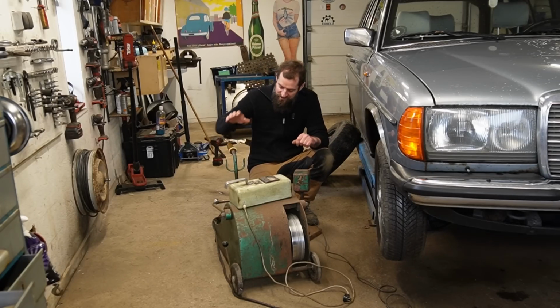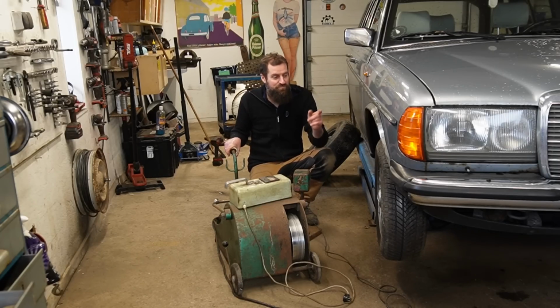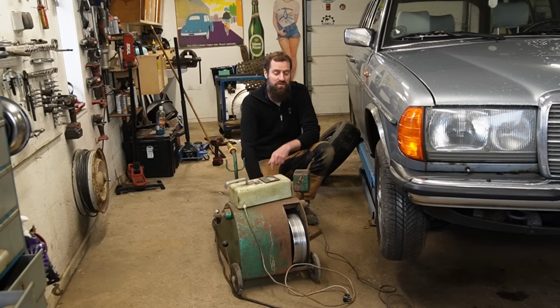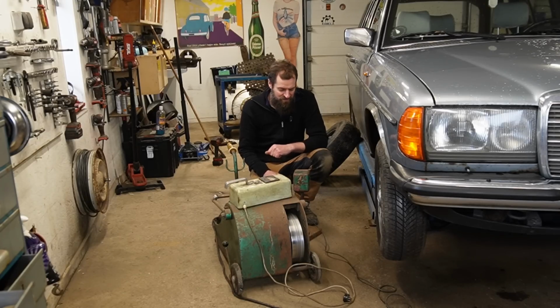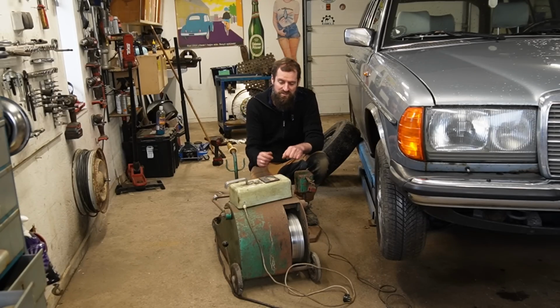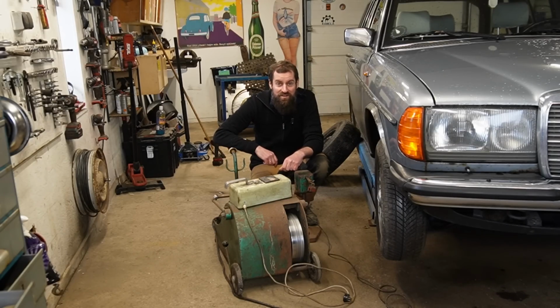It consists of this gigantic heavy unit with an electric motor that can spin up the tire by pressing down on this and pushing this. I can spin the tire. Then it consists of this, a pickup with a rod, so it can sense vibrations. And then there is this thing up here that will measure the amount of vibration, therefore the amount of weight needed. And it will also flash when the vibration is detected.